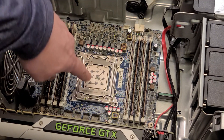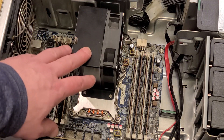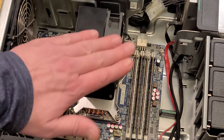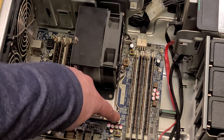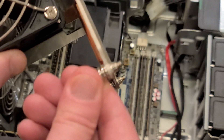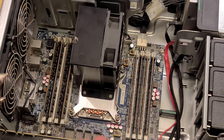Let me get this all cleaned up. I'm doing a nine-dot pattern right there — seems to be about the best idea. Here we are with it all stitched down. You just want to go crossways and slowly get it sunk down. Anybody who's done this before knows what I'm talking about — it's just general mechanics. When you have a plate, you want to try to evenly go down so it pulls parallel instead of rocking back and forth. These screws you have to press down against the springs a little bit to get them to engage the thread, which can make it a little bit of a hassle. They actually have a little shelf, so as soon as you feel it stop, you just give it a little bit of torque and the springs themselves provide the tension.